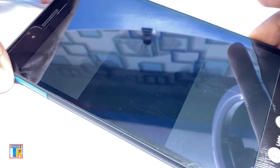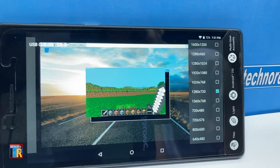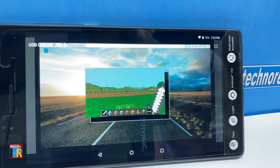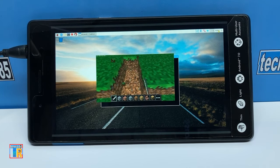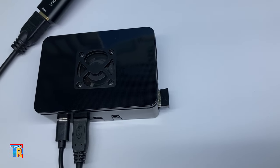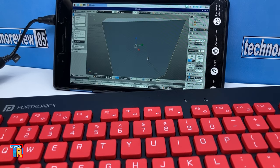My Raspberry Pi 3 is booting. The capture card supports HDMI input resolution up to 4K, and the maximum output resolution is 1080p. You can choose the resolution as per your tablet — I have chosen HD quality at 30 fps, which is working smoothly. Above HD quality it runs slow. Note that touch and audio are not working; you can use it only as an HDMI monitor. Now connected to Raspberry Pi 4, I'm running Blender, which is a 3D modeling and animation software — you can see it is running smoothly without any problem.